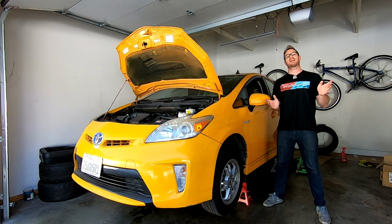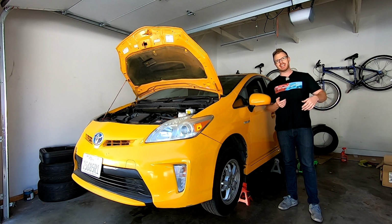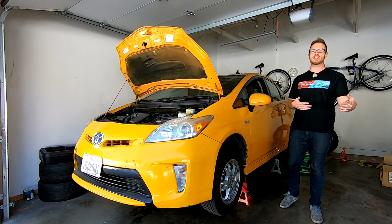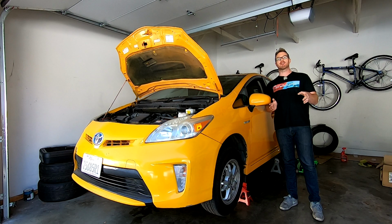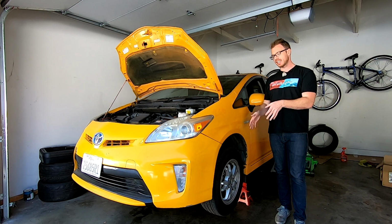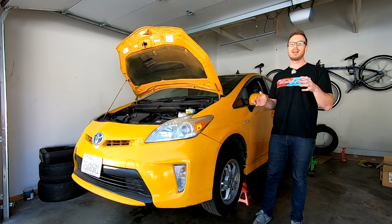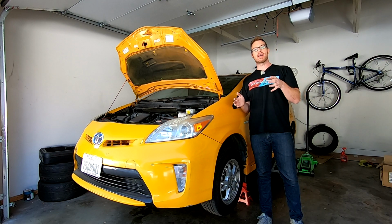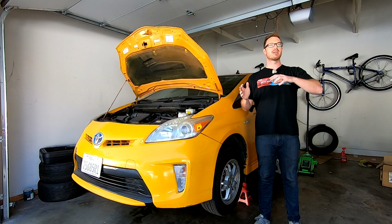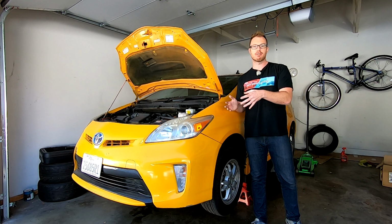However, with this search came a catch. When you talk to drivers of low-power cars at your local track day, think NA Miata, old-school Hondas, or even the Toyota 86 and Subaru BRZ, there does become the question of, can you go too big? Some racers think there's a point where over-tiring a car, putting too wide of a wheel and tire setup on a low-power car can actually hurt lap times more than it helps, because the increased weight and the increased drag down the front straight hampers or offsets any gains that you'll find in cornering grip in the low speed stuff.